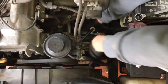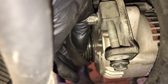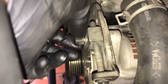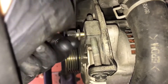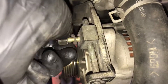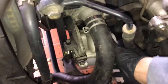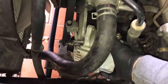Now we're moving. I'm loosening this bolt and pushing the alternator toward the engine block to loosen the belt. We can slip that belt off. Now we'll just go ahead and take this bolt all the way out and get this thing out. Might have to drop it down — there it comes.